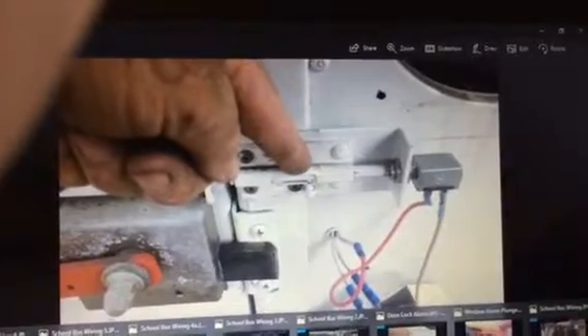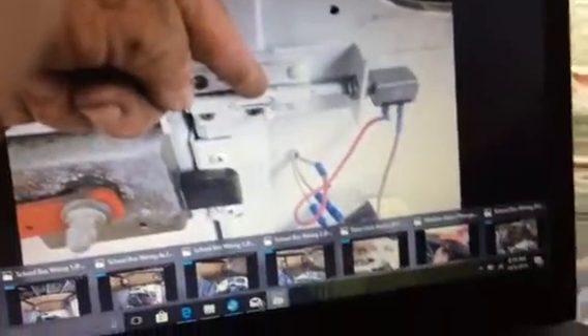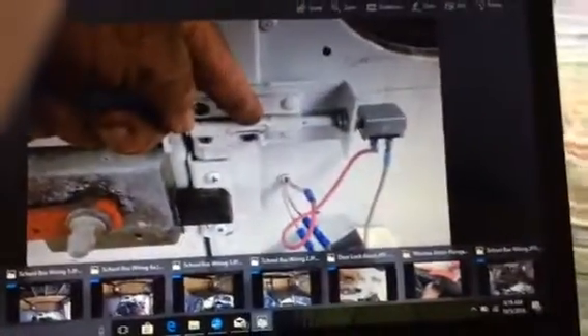That has occurred to us in the past in assorted skoolies. You can remove that entire area. You'll see there are structural supports in here — welded steel. They are there specifically to hold that device, nothing else, so they can be cut away. You can see we've cut it away here. And then you have this whole front configuration, which also supported everything that was going on here, which is a huge amount of wasted space.